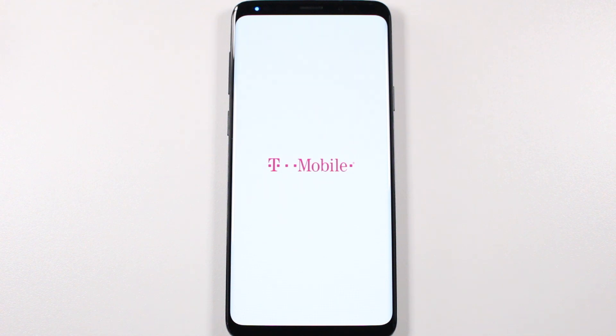If you're not able to take off your Gmail account, you don't want to just factory reset the phone and give it back or turn it in, because it will brick the phone. If you turn it in to the store or sell it to someone, unless they have your Gmail information, they're not going to be able to get past that to set the phone up. So just wanted to give an FYI for anyone that may run into that issue when trying to factory reset their phone.